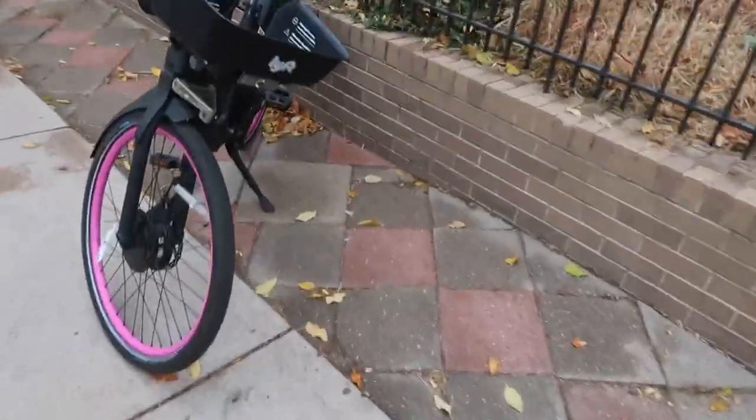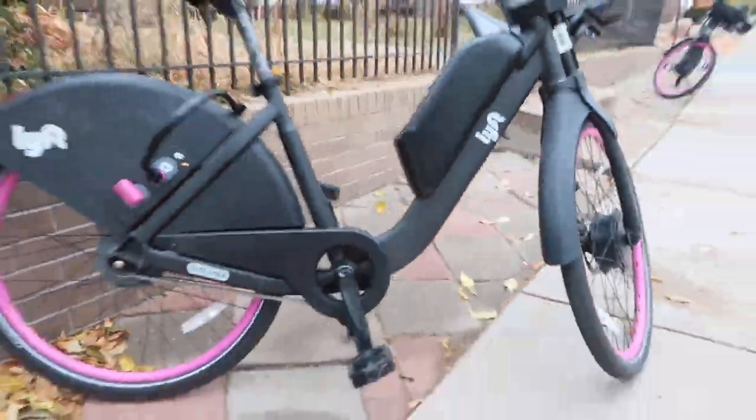That's what I'm guessing. Unlike other electric bikes, one thing you've got to be aware of on this particular bike is that it definitely wants to kick in the power pretty quickly. Once it detects rotation, you'll start pedaling and it'll feel real hard, and then all of a sudden you'll feel that power kick in, and that power might kick in faster than you're intending. So you've got to be aware of that. A lot of your city bikes and a lot of your bikes that have actual torque sensors in the cranks ramp the power up according to how much pressure you're putting on the pedals, so it's a lot more precise control.